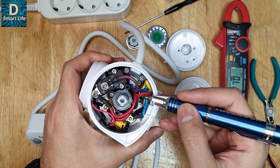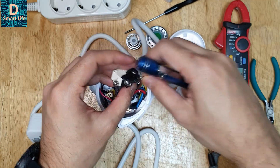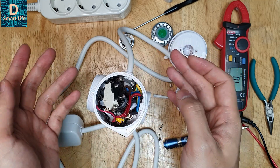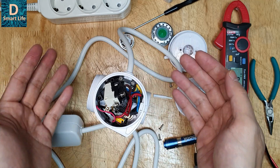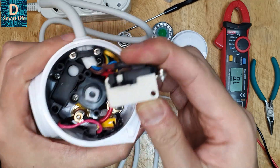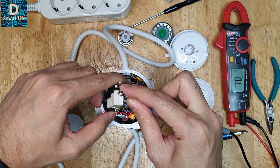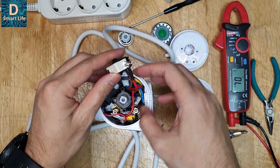There are very nice cutouts for the wires to go through. This is the main switch that cuts off power when you close the tap. This switch is very nice — in this case they are using a switch that can only be turned on or off, with no in-between state. This avoids the problem seen in some cases where switch contacts don't touch properly under low pressure. It is rated at 16 amps, which is quite good. The continuity test confirms it connects cleanly with no in-between state.